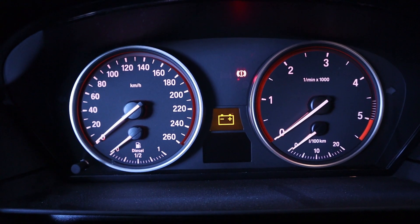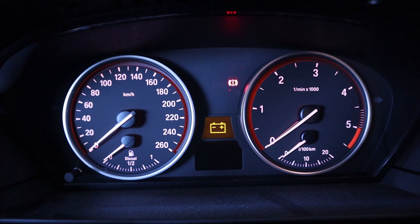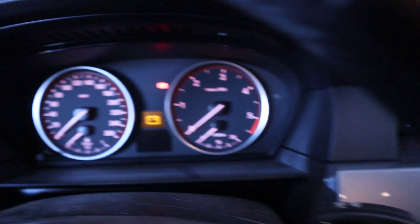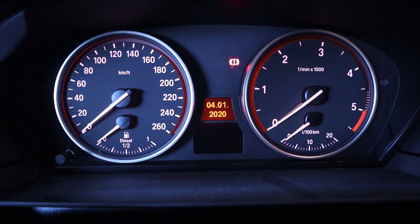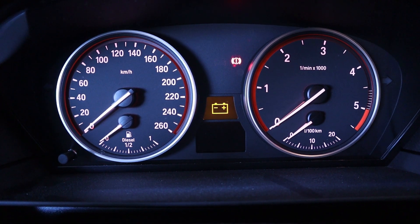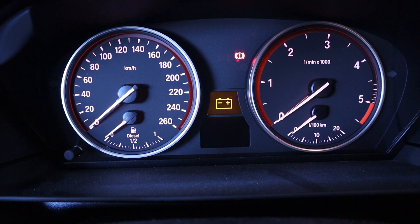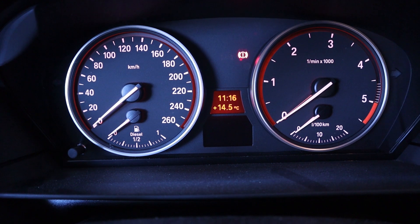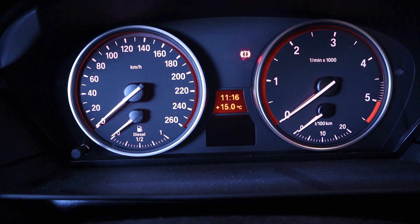This is the car that my wife uses on a daily basis, and for some time now she's been getting a battery message and also another one stating 'increased discharge battery'. I ran some tests and concluded that the battery is very low. When the car is running the voltage is about right — around 14.2 volts — so the alternator is working fine. But when you start the car, the voltage on the battery drops to around 8 volts. That means the battery is almost done.